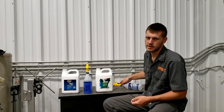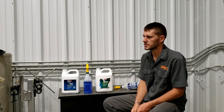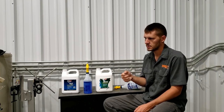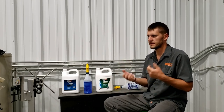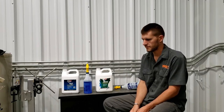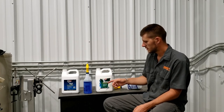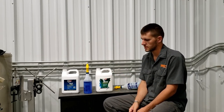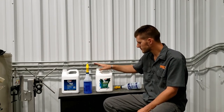And you know, I'm working on a freshly sandblasted frame, relatively. I welded on it for a week, so basically there was some oil that came out of my air sander that got on the frame at one point, and then my loading straps have some sludge on them from moving projects around. So some real light stuff, but then the soot around the spot welds that I put on, you can see it just pull all that soot off those weld zones, just pulled it right off. And then you wash this off real thoroughly with a garden hose, and then you dry it.